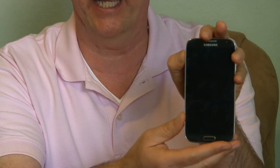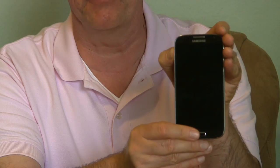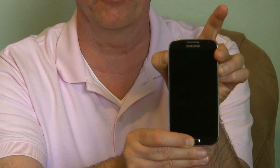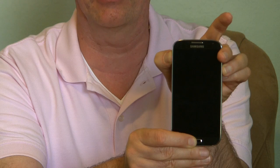To wipe everything out in hardware — keep in mind this will wipe everything out. You'll lose all the photos, videos, contacts, music — everything will be gone from the phone. So be sure you have it backed up and be sure this is something you really want to do. You'll need to know where the power button and the volume buttons are. The power button is over here and your volume up and down are over here. To initiate this process, which is basically booting into the subsystem underneath what you normally see, hold Volume Up and the Menu button at the bottom center simultaneously, then press the Power button as well. Press all three simultaneously until you see the Samsung logo.